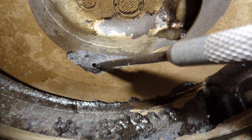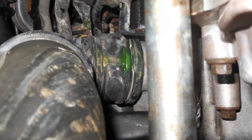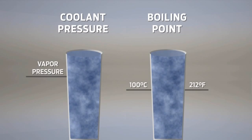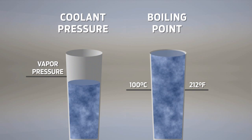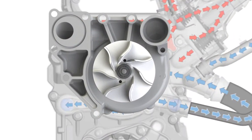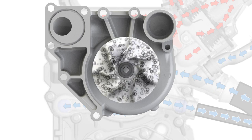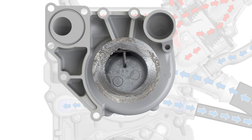Cavitation is a form of erosion. It's caused by low cooling system pressure due to leaks in hoses or connections that allow the coolant to drop below its vapor pressure. When the cooling pressure drops, the fast flowing water pump creates a low pressure area, which reduces the boiling point of the coolant. Like water boiling, air bubbles in the flowing liquid rapidly form and burst. The energy created by this bursting action is what erodes away the front cover material.